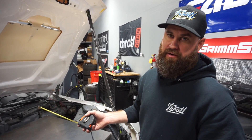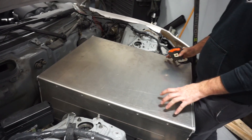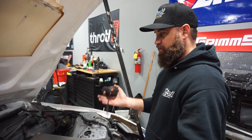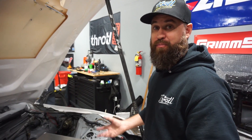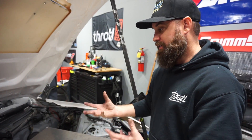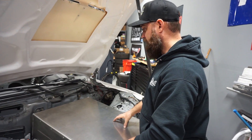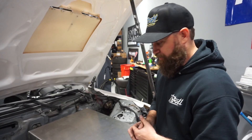The rear box is now mounted and we're happy with how it turned out. We're moving our efforts to the front. I've already sort of shored this up — this is going to carry a lot of weight, about 600 pounds, but it is replacing the weight of the V6 engine and transmission and all the other stuff, so it's kind of a push on weight. Unlike an engine, it doesn't move — it needs to be hard mounted. Our batteries are suspended inside this box for a little isolation, but we can hard mount them since that's how it's done in a Tesla. This battery box is now sitting on top of our subframe, which is going to carry the majority of the weight, and we just need to figure out how to shore it up so it doesn't slide around.